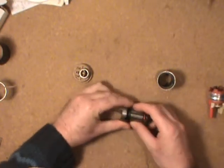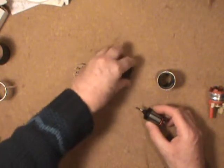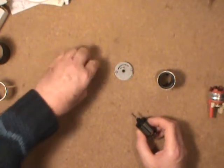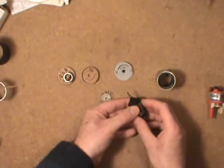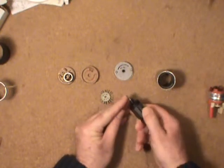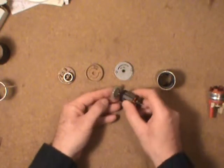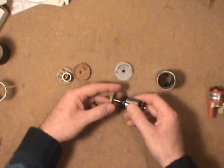There's the motor shaft — it's got a double drive system on it. For the low pressure pump's impeller, there are two flats on the armature shaft itself. It just basically fits into the impeller, and that spins inside the housing in order to get the fuel up to the high pressure pump.